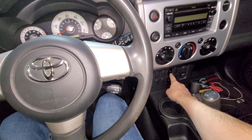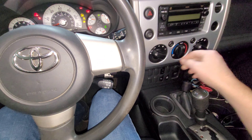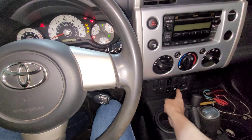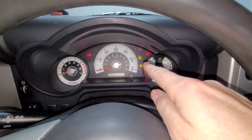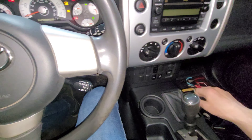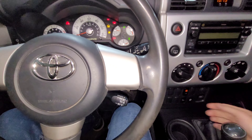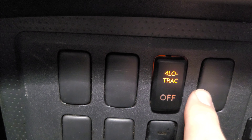I currently have the four low TRAC off. I'm in four low — four low TRAC is off, you can see the light is off, and on the dashboard you have the squiggly car indicator. Now we're going to turn it on. The light turned on here for four low TRAC, and your squiggly car is missing. Now we have four low TRAC on. Taking it out of low range into high range and the light turns off by itself — and again, no squiggly line. You just stick it into four low and the light turns on — you're good to go. Normal driving when you don't want that extra traction, just flip it off. This is a custom push button — you can get it on Amazon, I'll probably give a link in the description.